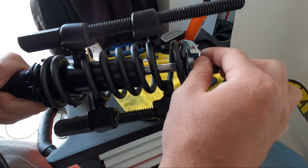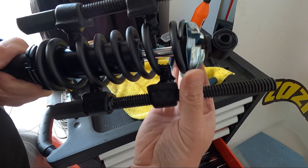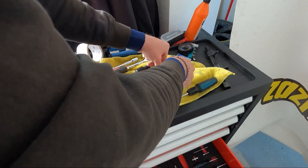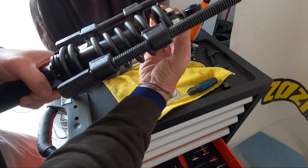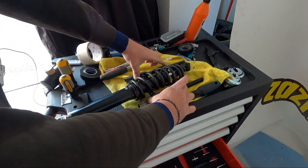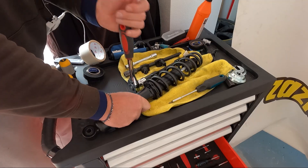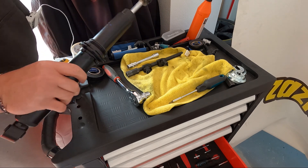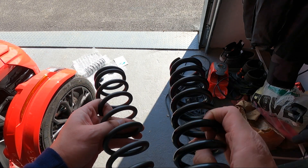As you can see, you can now freely move it. I don't want to talk a lot because honestly this is one of those jobs I don't like that much and have very big respect for. It works like this — and then the other one just like this. Now you need to remove the spring compressors again, one side then a little bit of the other alternately. And this is your spring at the moment — we're going to replace that with this one.